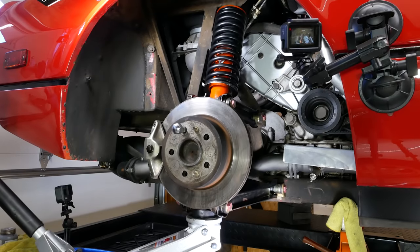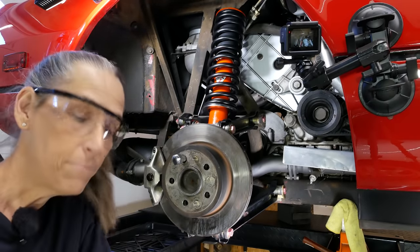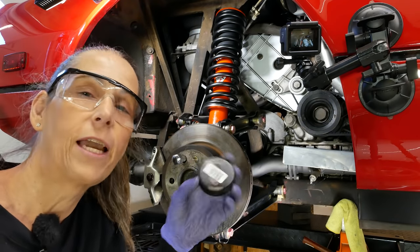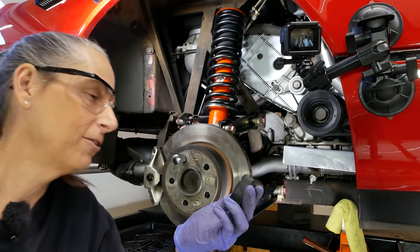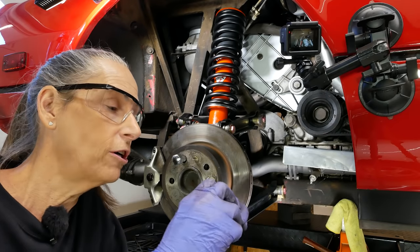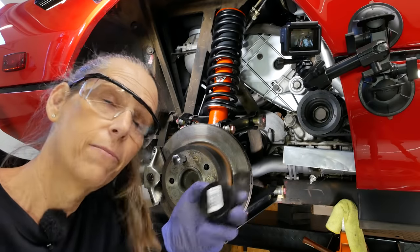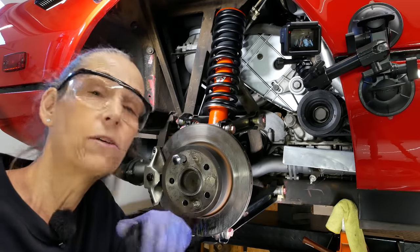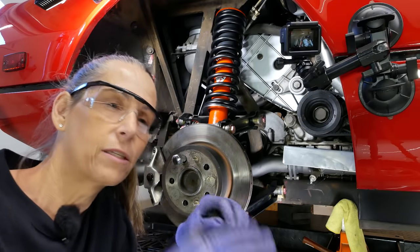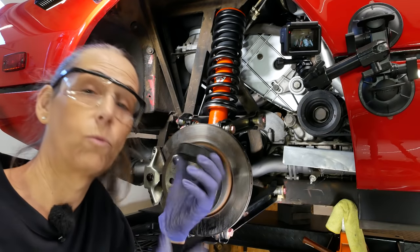All right, let's go ahead and lower the suspension back down, and I think that'll pretty much be it. Somebody had mentioned that I should get a set of hockey pucks, and they literally just came about an hour ago. I ordered these weeks ago. They took forever, I guess. But anyway, these things are great. Literally a hard piece of rubber, which is perfect for putting underneath the suspension bits when you jack it up. I was using a piece of wood and then maybe a towel over it, but that's not super secure either. It could slide because of the towel. The suggestion of the hockey puck was a great suggestion and works really, really well.